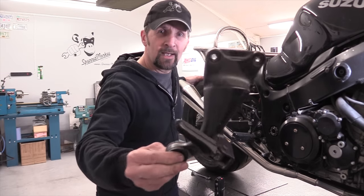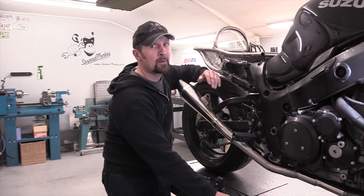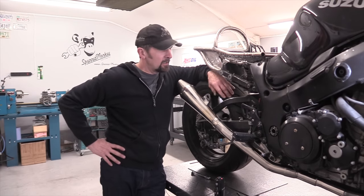Looks like something off a Scammel handyman, so that ain't gonna work. I'll make something that's in keeping with the rest of the bodywork that I'm making. I've got some of that 8mm bar. I can turn up some stuff on the lathe to make the little lugs, and I'll weld it together and make a nice little exhaust hanger in the next video.